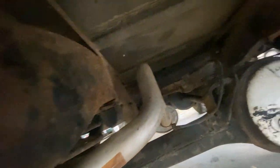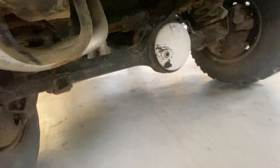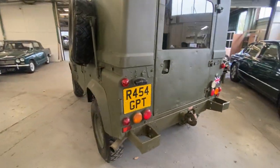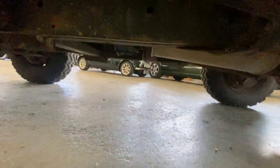On the chassis there — I'm trying to show you as much as I can. A little bit of surface rust but nothing major. It wants a bit of underseal, but the current vendor has left it like that so people can see what they're buying. You're not buying something that's absolutely tarred with underseal, get it home and find out it's all rotten. Wheels and tires all look good. The chassis looks all right to me — a little bit of surface rust wants cleaning off but it doesn't look too bad at all.